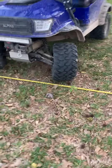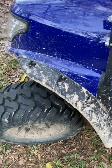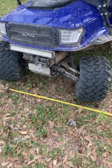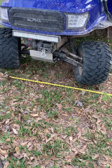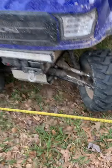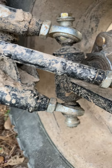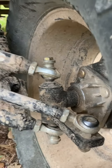But again, it rides really nice. The front end is still pretty quiet. With other basic six-inch lifts you can buy on Amazon for four or five hundred bucks, I've broken the leaf springs in those and they make all kinds of noise. Haven't destroyed anything on this — all the stuff is pretty beefy. I do tighten these bolts up regularly and I have permanent thread locker on.